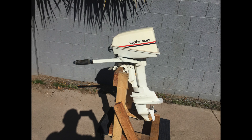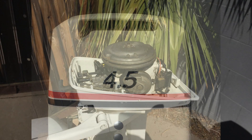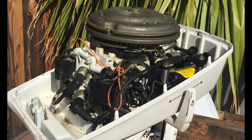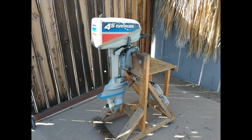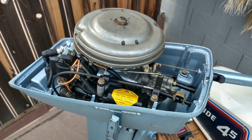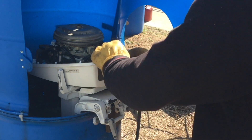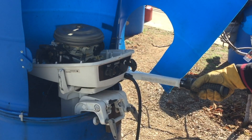In 1980, the last updated model with 4.5 horsepower was offered in stores with long and short shaft. The new design had a different engine cover with better airflow for the carburetor. The engine has a new base carried over from previous models, and is updated with a new flywheel, CDI ignition, external coils, and a new fixed main jet carburetor. Some outboard motors have an internal gas tank and a connector for an external one, with a complicated on/off fuel valve system attached to the choke. Models with an external gas tank are without this system.